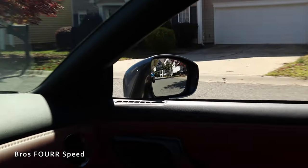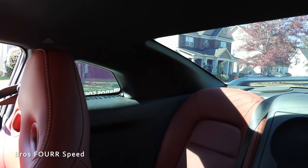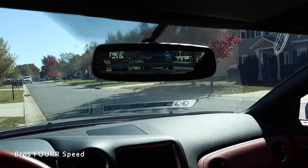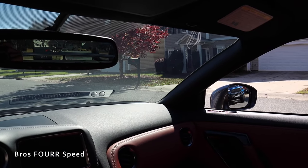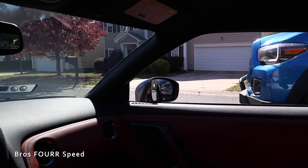Now we'll see how that same test works on the passenger side view mirror. With the Camaro and other smaller cars, a bulky C-pillar creates a blind spot over the right shoulder. Watching the rear view mirror, he's already in both mirrors at the same time — and by the time he passes, he's already there, still in the mirror. With the mirrors adjusted properly, just poked out that extra inch, vehicles passing left or right are always in one of the three mirrors or right next to me.